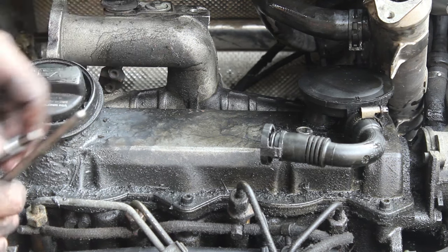All right, the intake manifold is clean now, but it is still very hot. You can see all the charcoal bits of burnt diesel boogers laying on the ground, which we'll clean up and dispose of properly. And now that we are waiting on the intake manifold to cool, we are going to clean up the EGR valve. Okay, here we are going to take our diesel booger screwdriver and simply work at scraping as much of this stuff as we can out of here. Once that is accomplished, we will clean it out most likely with carb cleaner or gasoline or diesel, some kind of solvent like that. But we won't set this on fire like we did the intake manifold.